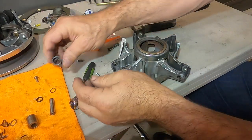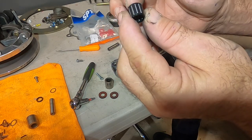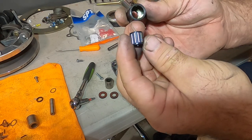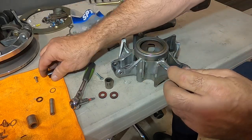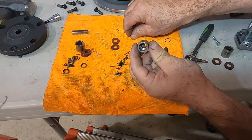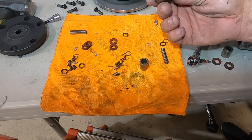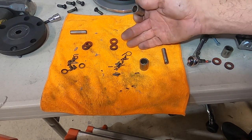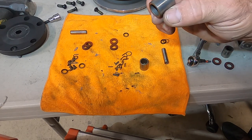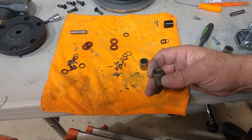This is supposed to have a roller bearing inside. Here's a brand new one — you can see it has a nice little roller bearing and roller cage in there. But what happens over time is this cage breaks apart and you start grinding up the roller cage material. My snowmobile has about a thousand mountain miles on it, and when I pulled these apart, you can see all these broken pieces that came out of the inside of this roller. Another one came out all broken apart like this, and this was only with a thousand miles. So it's something worth looking at. I was just going to pull this apart and re-grease them — I didn't know they were all going to be broken apart like this.